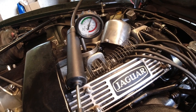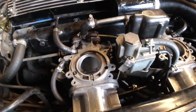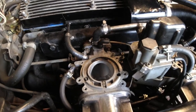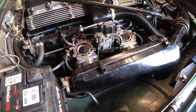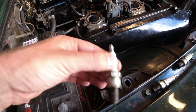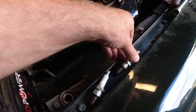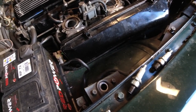It's been about 10 minutes and the pressure is going down slowly — it was at 16, now it's at 14. I haven't seen anything obvious in there; before there wasn't water standing but I could see some droplets. I decided to pull the spark plugs — the last couple times I've just moved this car briefly and it's running on the automatic enrichment device mostly, so I expected them to be rich. They're all black, and the funny thing is they're all even, so that alone doesn't indicate one cylinder is consuming coolant.